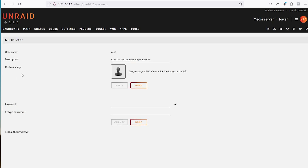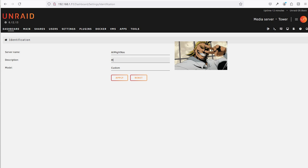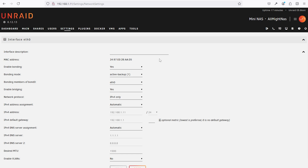Let's change the default password to something better than 123456 — click on Users, Root User, type in the password and save. Now let's change the name of the LinkStation to something cooler. In the dashboard, click on the little cog wheel — I'm naming mine 'All Might NAS'. Do you guys know which anime series that is? Let me know in the comments. Let's also set up a static IP and DNS servers: click on Settings, Network Settings, change the IP address assignment to static, and change the IP to whatever you like — just make sure it matches your network ID and that the IP is available. I'm leaving my DNS pointing to Cloudflare and Google. Click Apply, and go to the IP address you just set up. If it hangs, wait five minutes and hit the power button to shut it down — that did happen to me, so the device needed to be restarted.